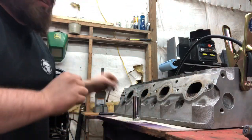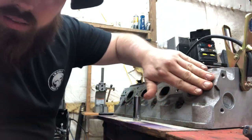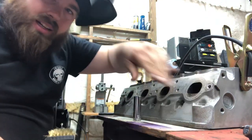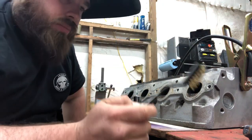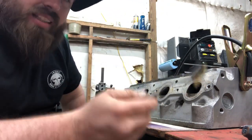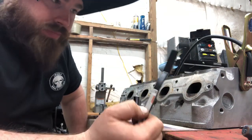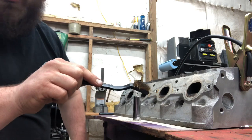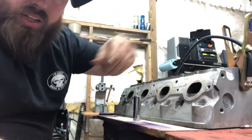Take your wire brush and brush the outside off. That's not even hot — when we got done with that weld, it was red hot. This head surface isn't hot at all. That's the difference. That's part of the reason why aluminum heads are so much better for temperature control — they displace the heat so much quicker with the coolant that's in them than cast iron heads do. That's just proven right there: a bolt-on red-hot metal that I wouldn't even touch right now, compared to the head surface we just welded on — it was in the same temperature range and it's cold to the touch.